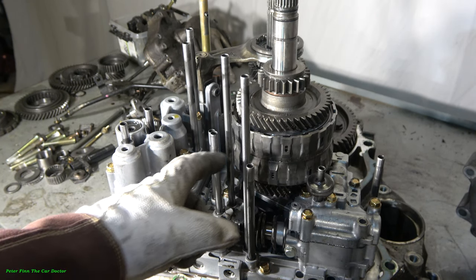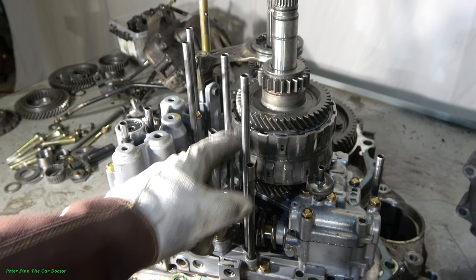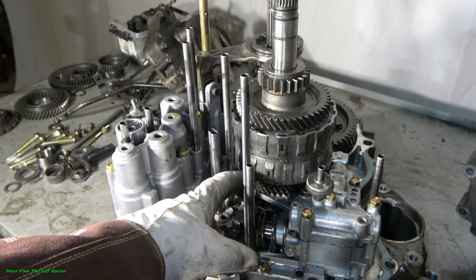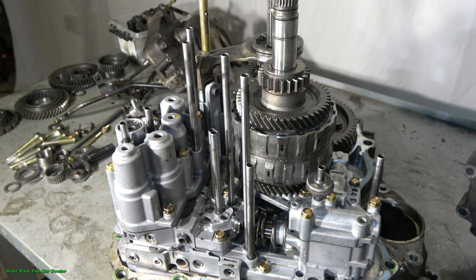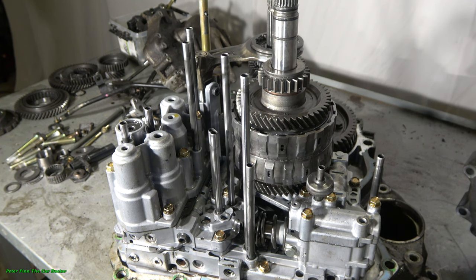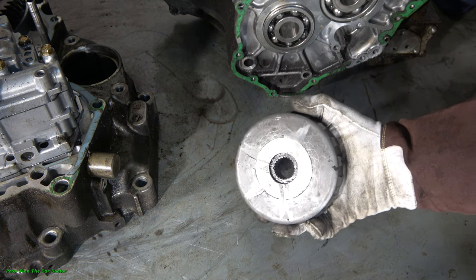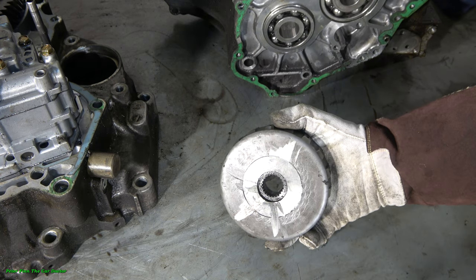And this inner area of this automatic transmission, and inside in these packages there are similar clutch plates that we can replace. But next I open this clutch plates package so that we can see how they are made and how we can install those. Okay, and here we have this clutch plates package, and firstly we have to open this nut.